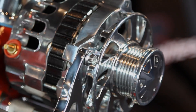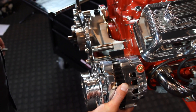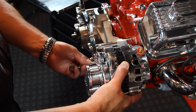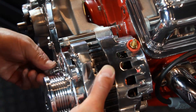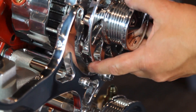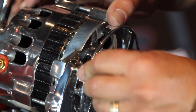Standard TrueTrack kits include a 140-amp polished Powermaster alternator — each component is the best in aftermarket performance. To mount the alternator, position it onto the bridge bracket. Run the bolt with anti-seize on the threads through the bridge bracket and alternator into the alternator bracket. Swing the alternator upwards and align it with the top portion of the bracket. Install the ARP bolt to finish it off.